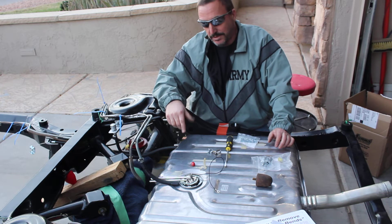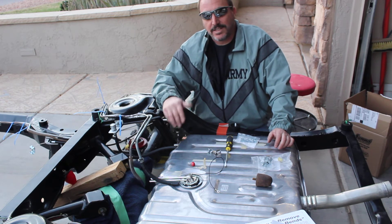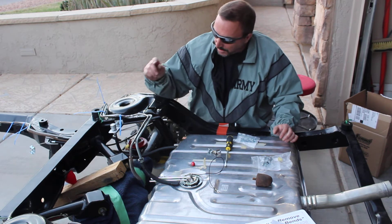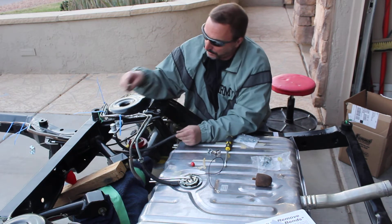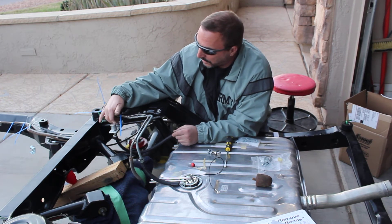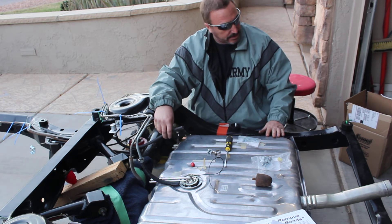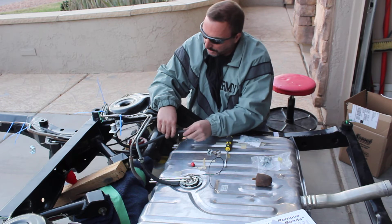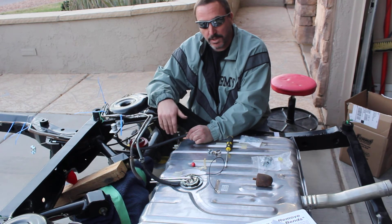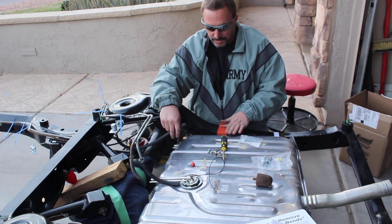The other thing you need if you're going to be getting rid of your vent line is you need to make sure you put a vent line back in. My biggest thing I want to avoid is vapor lock, so I still need a vent line — that's very important. I chose to put the vent line in with a rollover valve, as you can see if you take a look at this. I made an aluminum bracket attached to my rollover valve, and your vent line does need to be higher than your fuel tank — that's very important. You don't want fuel to come out of it; you just want pressure to vent out. So you've got to make sure your vent is higher than your tank. This is about where the tank is going to be sitting.